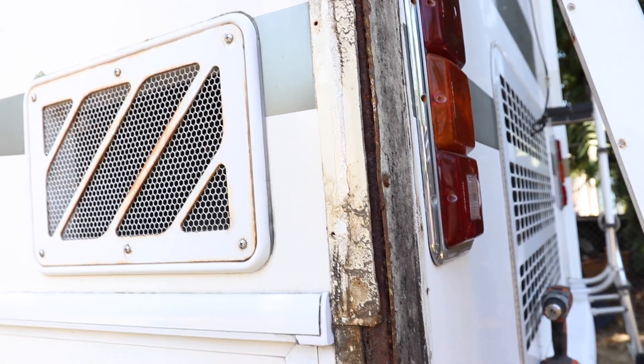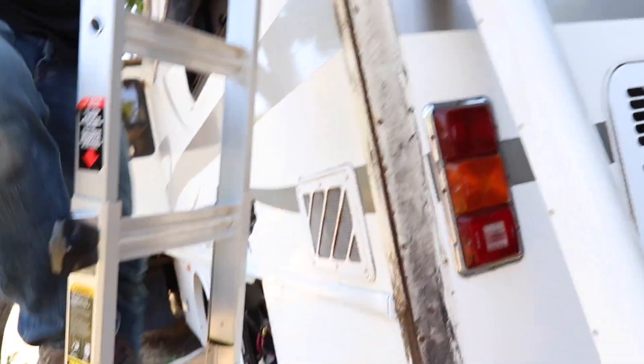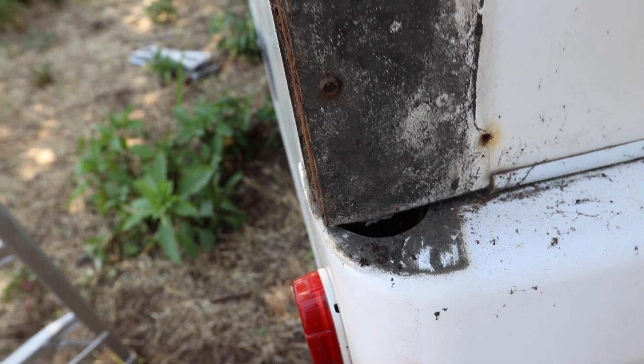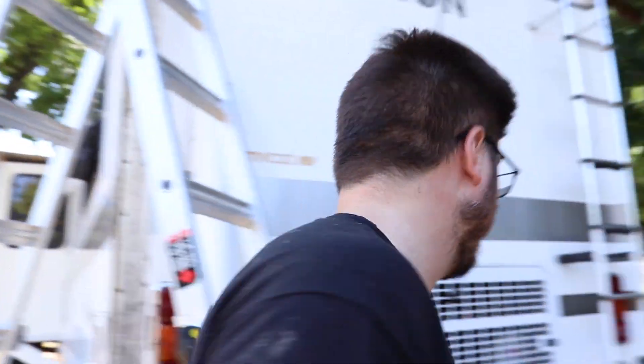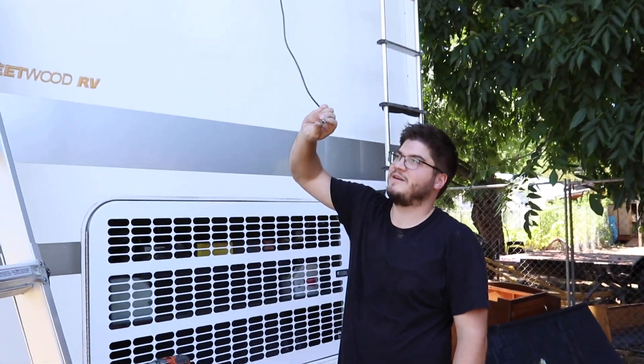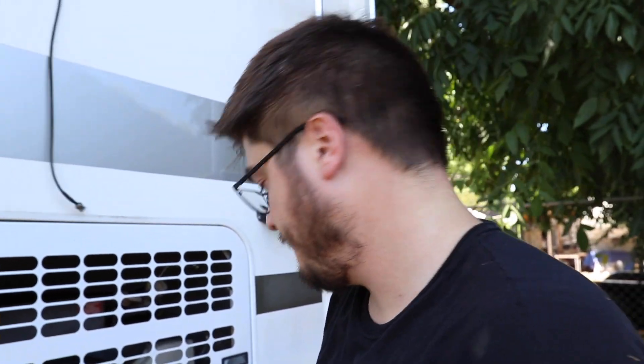We'll want to clean all of this and recaulk all the way up, and probably get some new screws. It's crazy — you see these RVs and they look so solid, but then you realize it's a bunch of plastic. Flimsy material on its own, but you screw it together properly and it's pretty solid. I'll run my new cable down here into this little hole and through the chassis. I can just coil the old one and put it back up — it's got a BNC connector, which is a quick-connect two-wire video connector, but I need four wires.